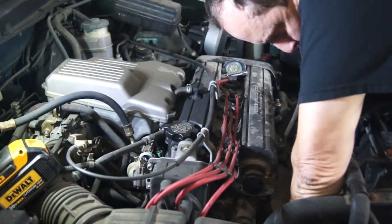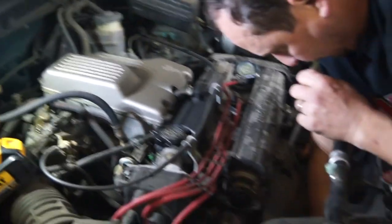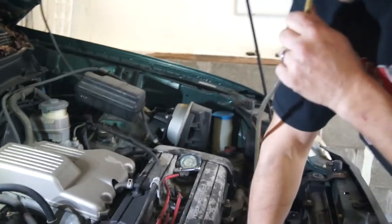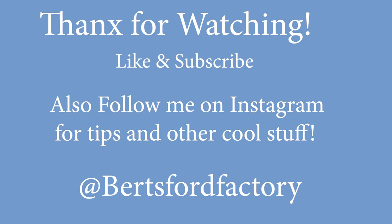What I'm doing right here is I've got a clear line — it's important to have clear so you can watch for fluid. I've got it connected to the bleeder, and I am sucking on the clear line and opening the bleeder to pull fluid through the line, because the line from the clutch master cylinder goes up the firewall and across and then down, so you'll never be able to bleed it that way without sucking fluid through the line. I'm sucking the clear line, opening the bleeder, and it pulls fluid through. Then I close it when I get tired of sucking on it, or when the fluid gets up close to my mouth. That's why you need a clear line — so you can make sure you don't get fluid in your mouth, because that brake fluid is nasty. There is a tool for this, but I'm too cheap to buy it, so this is the Redneck way.